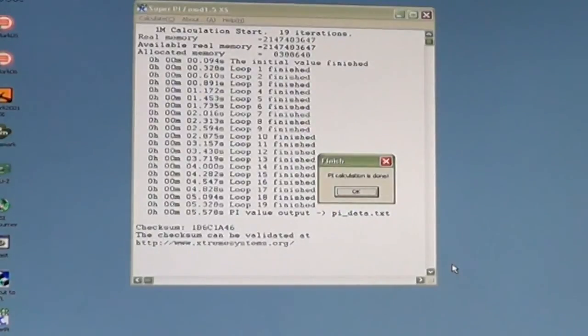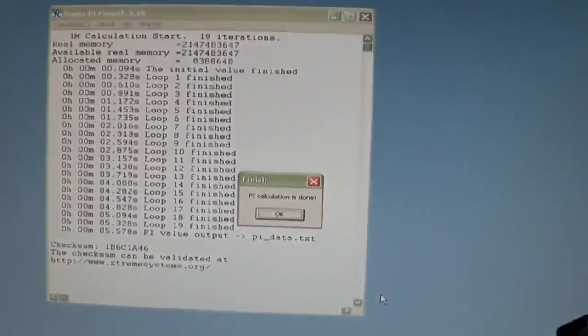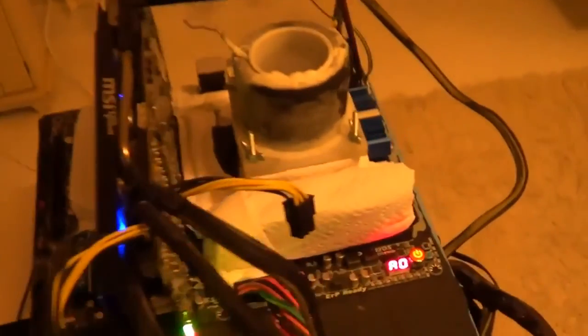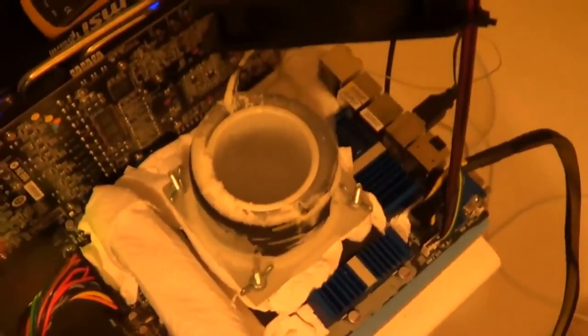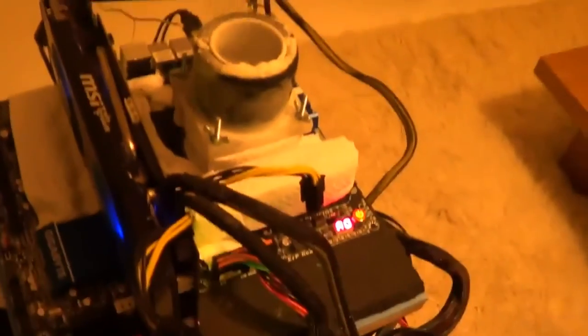Now you can just keep running. After about 2 hours you need to check your system, like I said, and see if it's happy. Once you run into some problems and you really can't get the same stability that you had previously, you should probably stop, cool down, take everything off and dry it out. Never fight this system. If you're starting to run into silly stability issues, even at stock speeds, you know something is watering up or something is not lacquered, so it's better to just stop and try again later.